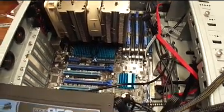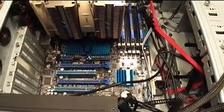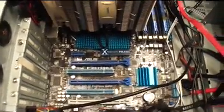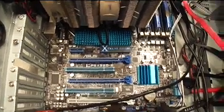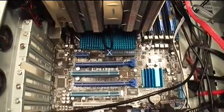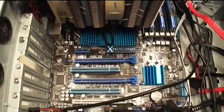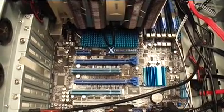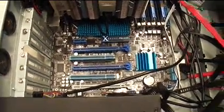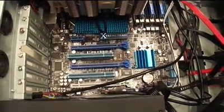The next piece to go in is the graphics card. This is one of the parts that I specifically picked out for this machine, mainly for the gaming aspects of it. Inside the machine, the motherboard manual will walk you through which slot is the best slot for installing one of these cards. You want to be careful about which slot you put it in to take maximum advantage of the bandwidth that the slot will offer on the motherboard for the graphics card, as well as if you're going to expand and run a couple or a few graphics cards at once. In this motherboard's case, we want to target the first PCI Express slot.